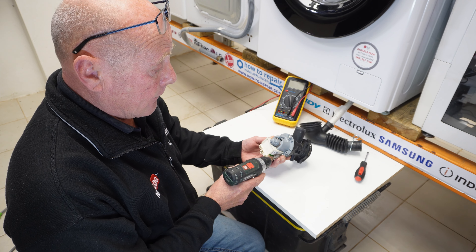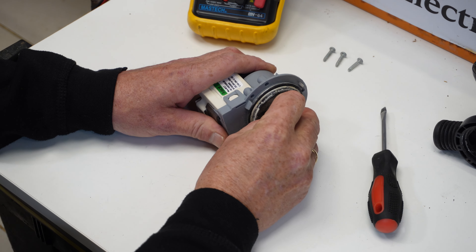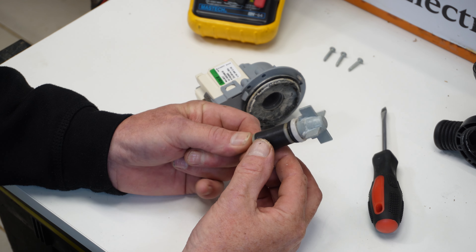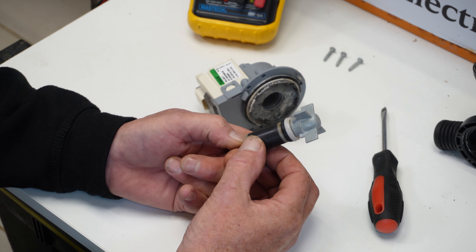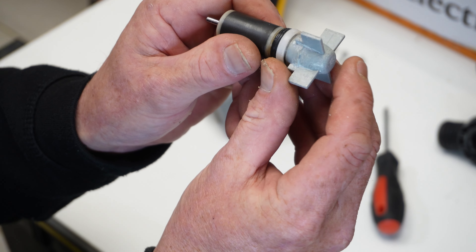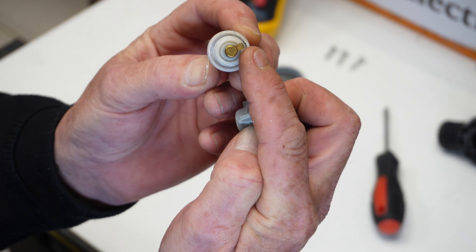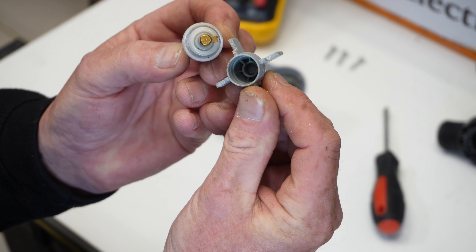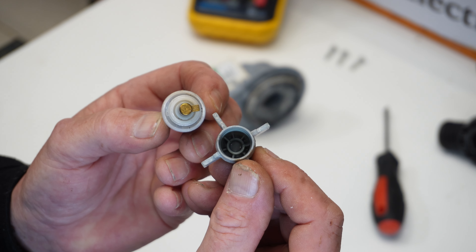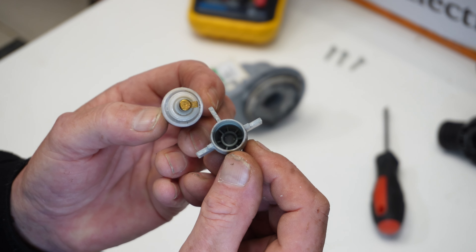Pumps either detach from the housing via screws or they have plastic clips that lock them in place. Taking the armature out of the motor — because this one is slightly different or damaged — you can see here is the armature attached to the impeller. When rotating, the armature is actually turning with the impeller, but under load the impeller was locking while the armature kept rotating. If I bring it up to the camera and separate the housing off, you can see there is a notch on the actual armature shaft. This is meant to be locking inside the plastic, but the housing of the impeller inside had broken and the plastic lugs that should be locking against the shaft have broken away. This means that this pump was unable to operate under load.